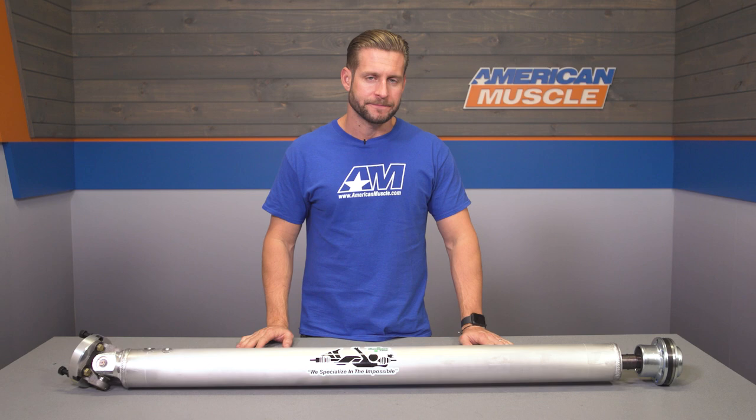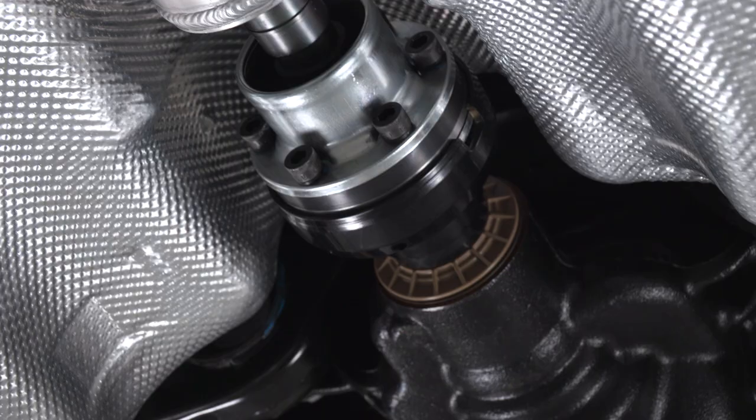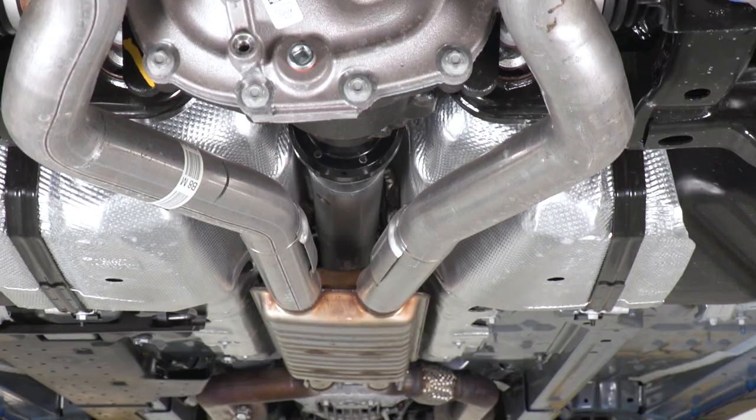The reality is traction is the destroyer of a lot of these components, and typically you'll see those half shafts be the first weak link once you dump that clutch and hook up on a sticky radial or bias ply. The second part that's likely to go will be your stock drive shaft, of course, so therefore I would certainly recommend doing some half shafts in addition to the drive shaft if you're really gonna go full send at the drag strip.